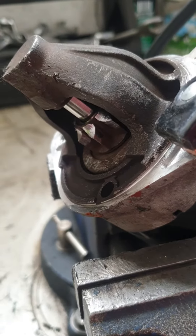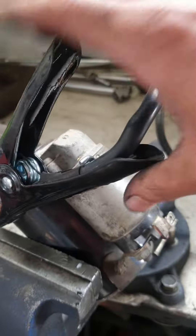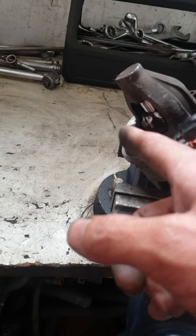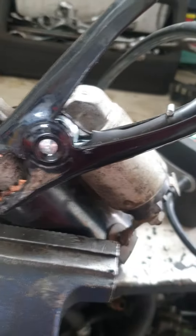So just wanted to show you: when you want to check the starter motor, put the negative power to the body and touch the positive here. If the gear is going forward and running, it's okay. If it's not going forward and not running, it means it's stuffed up — have to change the starter motor. That's all, thank you.